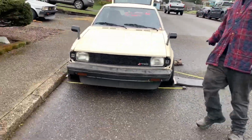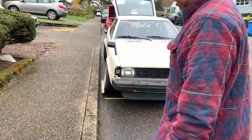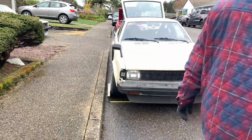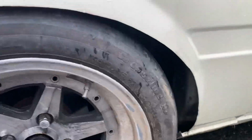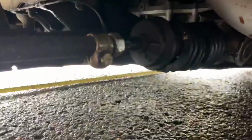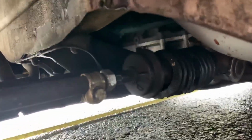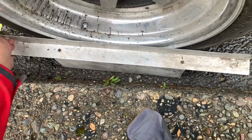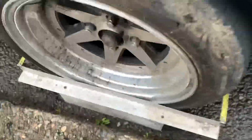I'm gonna say we're toed in on here. Both sides. This side more, huh? Yeah. If I just need to adjust one side, I would adjust passenger side. Looking at these, oh, because you're extended. I feel like we're maxed out. I gotta back out this double locking nut because I extended these things and I can't toe it in anymore. Look how bald the inside is. Too much camber. Pull on the back one a little more. Okay, right there. Right amount of tension.